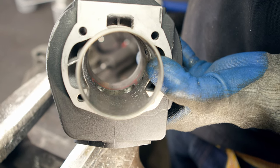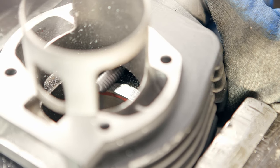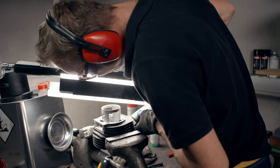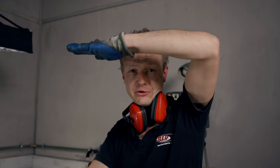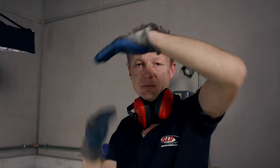The center I will do once the side walls are ready, because the top edge of the duct is the critical one — it defines our timing. If I exceed the timing, the cylinder is ruined. Another important thing is to make the top edge of the exhaust port round, because if it's straight and the piston ring comes up, it just crashes into that straight edge. But if it's round, it's softly pushed back inside the slot of the piston and moves easily over that edge.